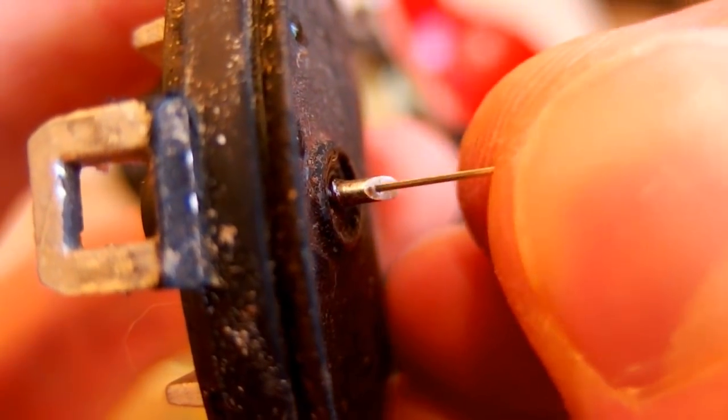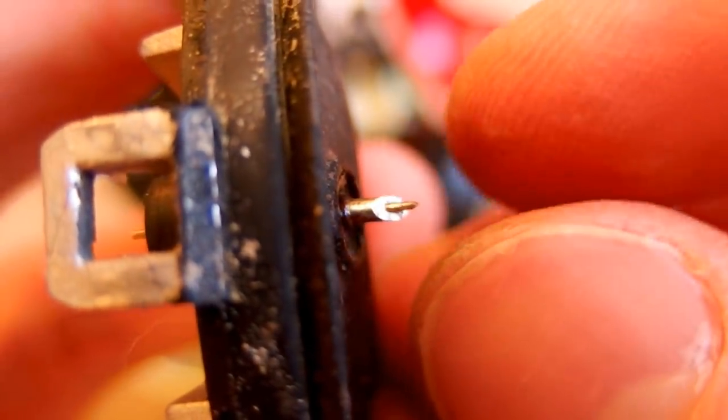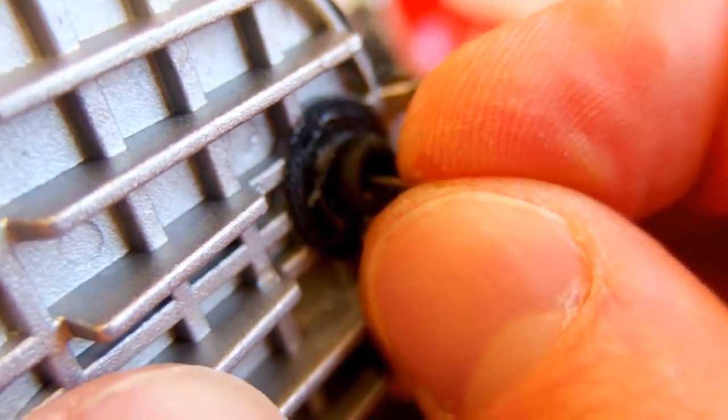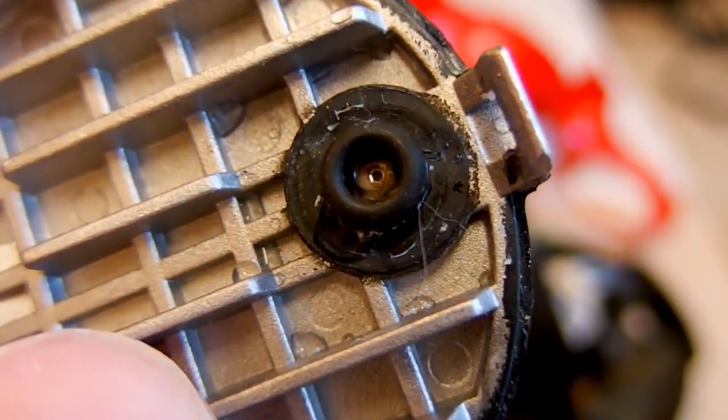This part comes off with the needle here. Let's test it - and yes, the needle is blocked completely. There are some minerals from the water or remains of coffee stuck in the needle. So let's just poke the needle using a wire - and it comes through from the other side. Now it should be okay.